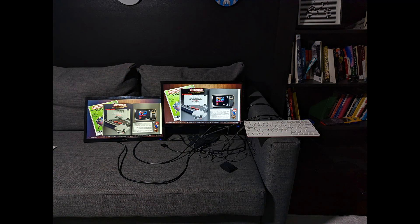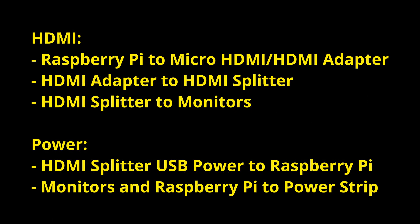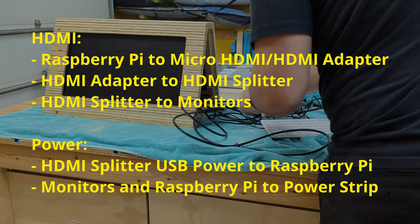There are a ton of resources out there that show you how to set up RetroPie — I linked a few that I used below. For my specific setup I used a Raspberry Pi 400 keyboard and an HDMI splitter, because out-of-the-box RetroPie doesn't play well with two monitors. You can probably do it with coding, but the easiest way is to spend twenty dollars and get this splitter. On screen is the diagram I used for the HDMI cords and the power cords — all the products I used are linked below.